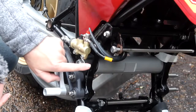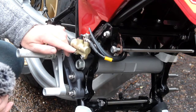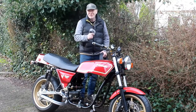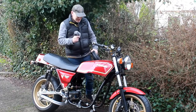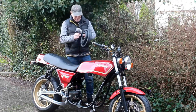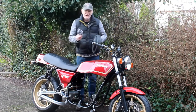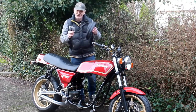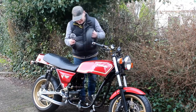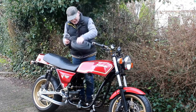Now here we have the new black anodized spacers on the bike and it does look a lot better. I know it's only a small detail, but details matter. And so now here we are — it's a week later and today is a big day for the bike and for me, because the bike is going to the workshop to get the engine fitted today, or at least later on this week. But before it goes I've got to prepare it for that engine fitment. So I bought this — two metres of foam insulation for pipework — I'm going to fit it to the frame rails to protect the paintwork on the frame and the finish on the engine when we have to lug the engine into the frame. Something well worth doing, otherwise you're going to chip the powder coat on the frame and no doubt damage the finish on the engine. So now I've got to cut this up and get it taped up on the frame.